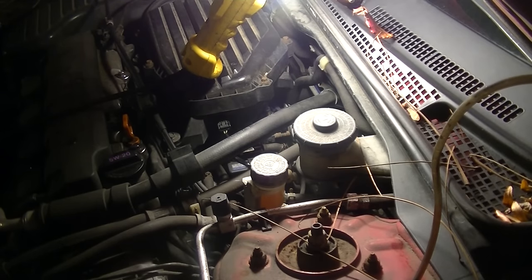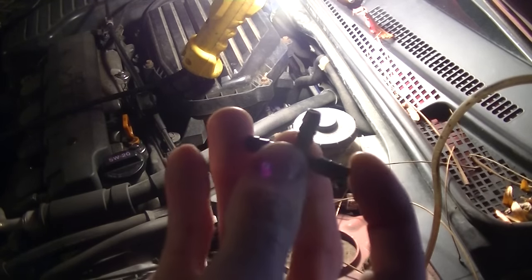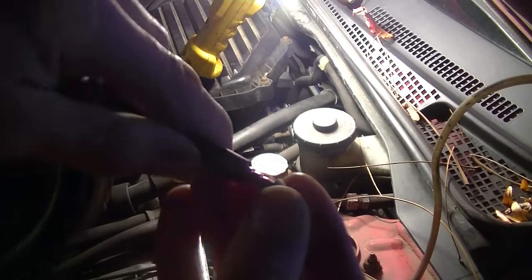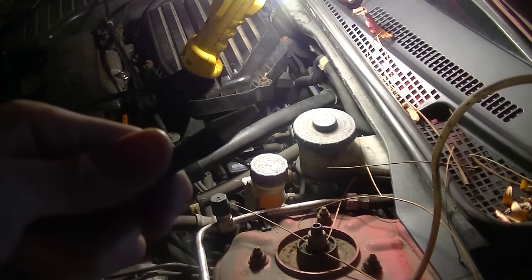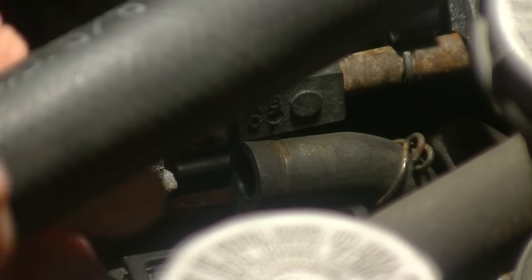If you get a good kit, your vacuum gauge will come with a bunch of fittings. They have a T fitting which is really easy to tap into a line — you put the gauge right here and then the line goes on these two fittings. I'm going to use this fitting right here, which can just go into my hose. I'll stick it into the line and since it's wet it's just going to create a seal and I can get vacuum from that.